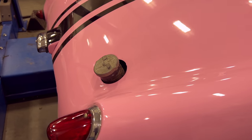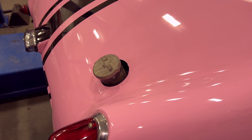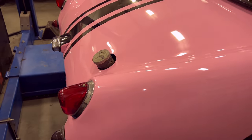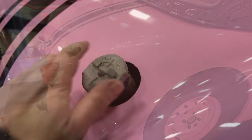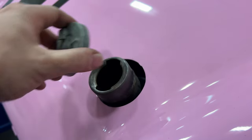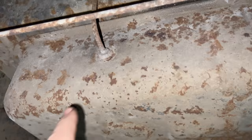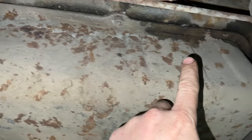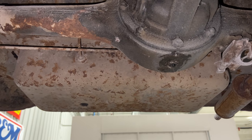This car has a beautiful new paint job but there's no grommet for the fuel tank. The fuel tank needs to be dropped out the bottom of the car so that the grommet can go on. That's okay because the first step in getting fuel up to the engine is making sure the fuel tank works. I'll take the fuel cap off so it doesn't scratch the body when it comes through. To drop the fuel tank, I need to disconnect the fuel line and unbolt all the bolts along the perimeter, then it can just drop down. The fuel sender is located on the top of the tank, so it's not accessed until the tank is lowered.